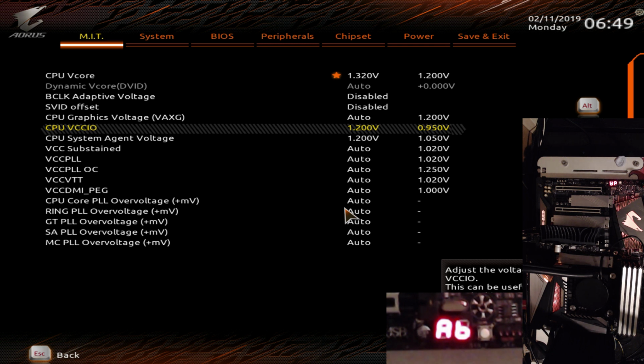That you can go all the way up to like 1.5 volts and it's just going to keep increasing your overclocking headroom. The issue with both of these is that they will eventually break your memory controller. So for long-term usage, I would not go above 1.35 volts on either of them. For benchmarking, I would stick to below 1.45 volts short-term. And if you're on sub-zero cooling, then you can go past into the 1.5-ish range, but I really wouldn't go that high.